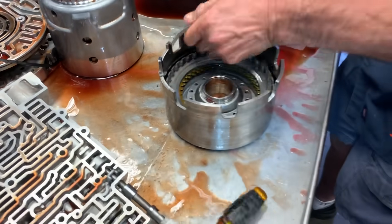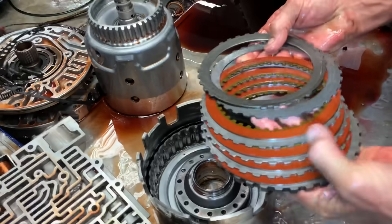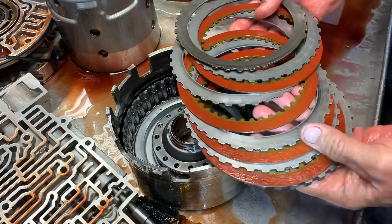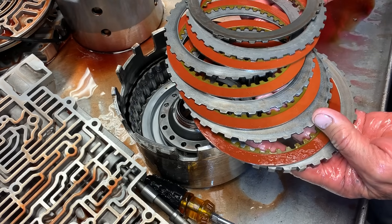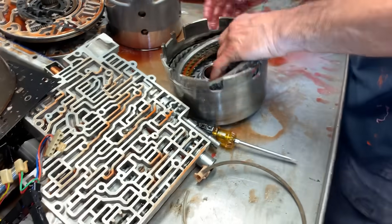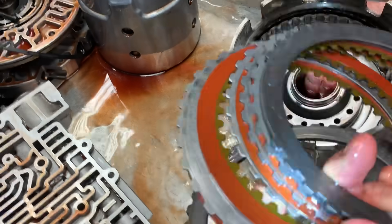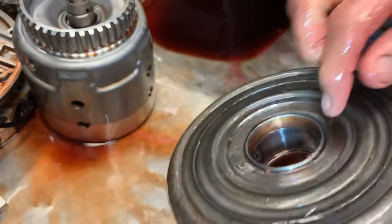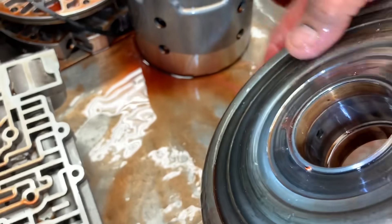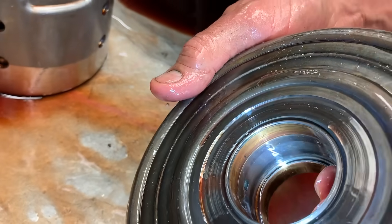This is your reverse clutch — it comes on in reverse and low. No modifications, it's been done pretty normal. You can see they got a really nice clutch in here — the clutch looks brand new. But for as new as these clutches are, these bushings are old and were never replaced at all. You can just tell by looking at how bad they look. When we do it, we replace all the bushings.